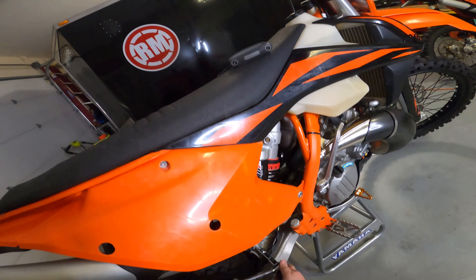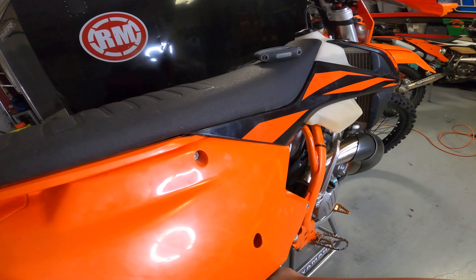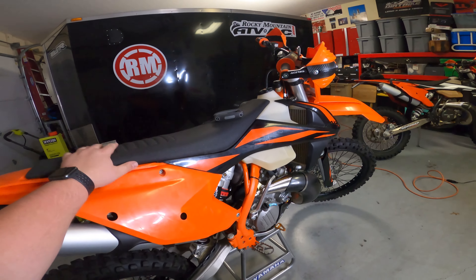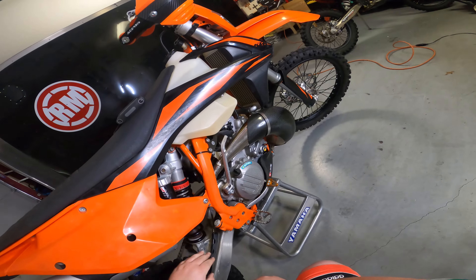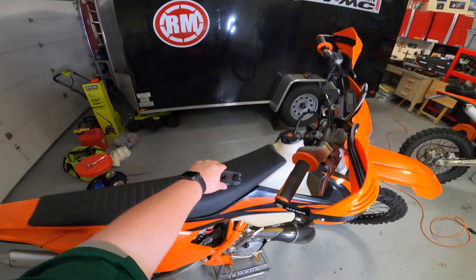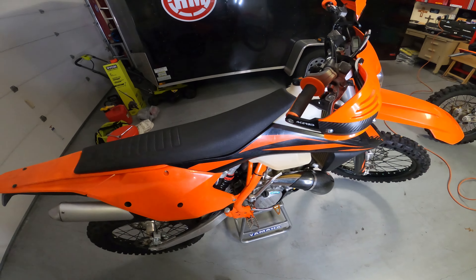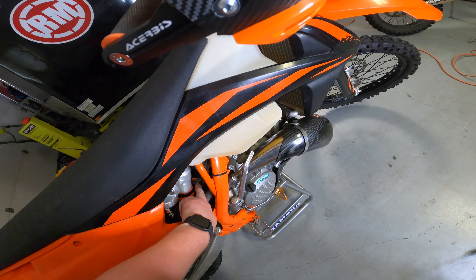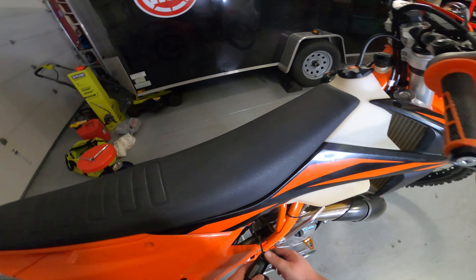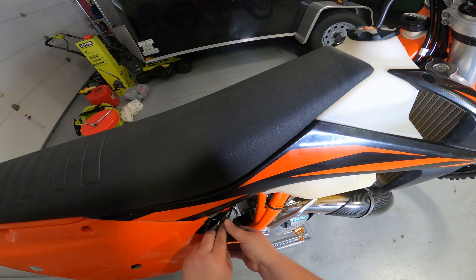The biggest thing is — if you're jerking and pulling on this bike, make sure your bike is on the stand. I had a little trouble there but I did get the hard part done: the spring is back on and the two big bolts are in. Now we'll take the allen key and get that little collar bracket tightened back down. I like to make sure it's visible so when I need to set the sag I'll be able to unlock it and get it set.